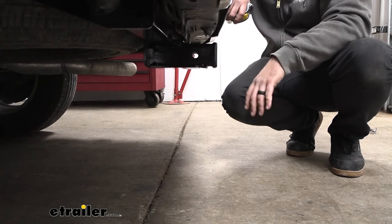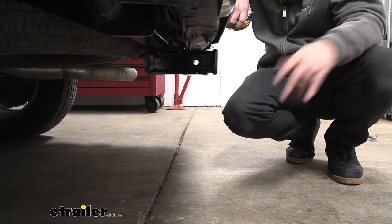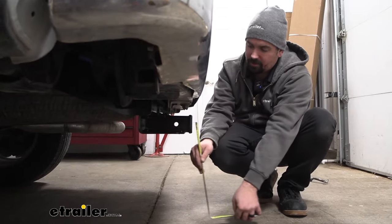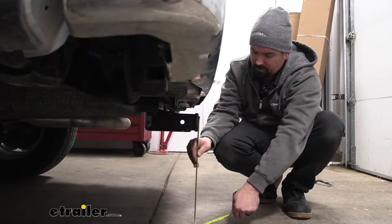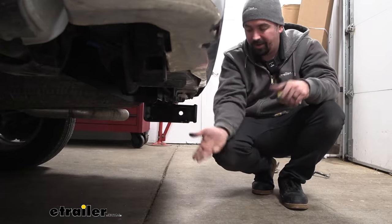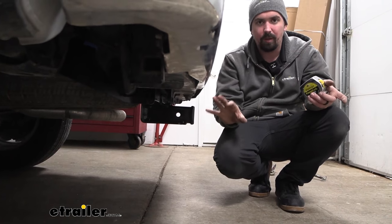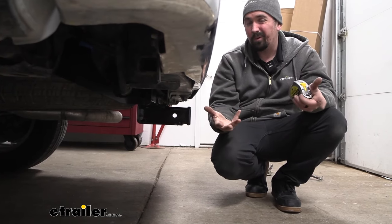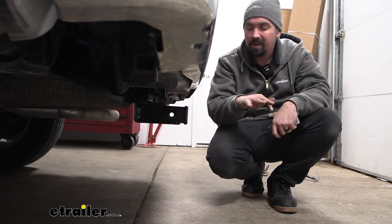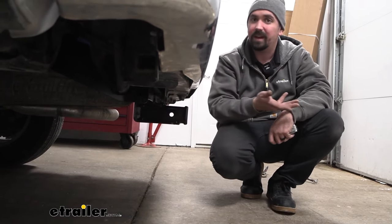Something to keep in mind with folding accessories: when in the stowed position, you probably won't be able to open your tailgate, but it's generally going to be empty so you can still lower it down and get access if needed. As far as ground clearance goes, this one comes in at about 17 to 17.5 inches, which is pretty good for suspended accessories. You'll want to make sure they don't bottom out on inclines, and this measurement is also important for choosing a ball mount and determining the rise or drop needed to keep your trailer level.